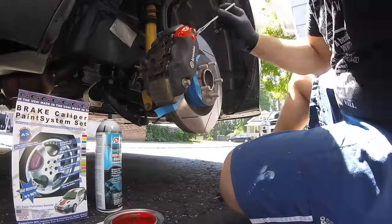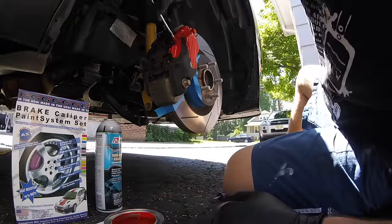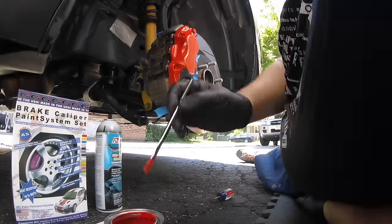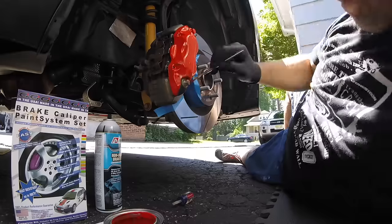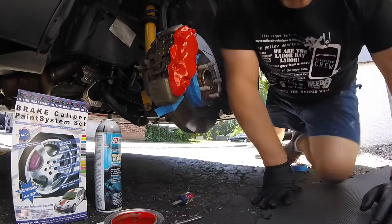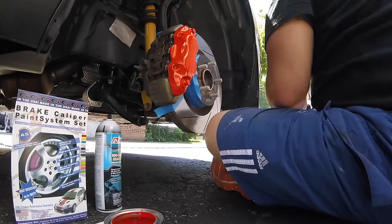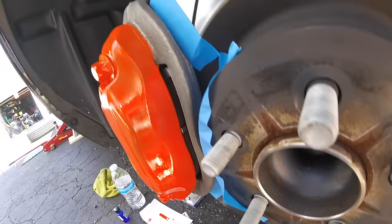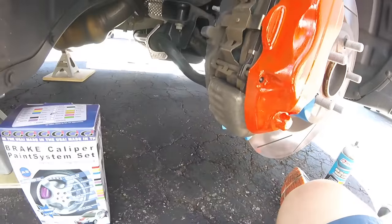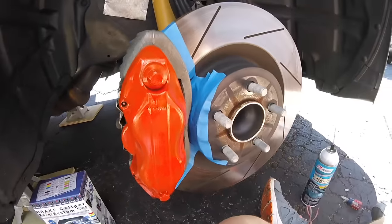Get comfortable — painting takes a while, about 10 minutes per wheel, more if you have a larger area. During the first coat the paint is a bit loose, so apply in light coats and keep an eye out for drips. After a few minutes on the caliper the paint thickens, and if you try to touch up those areas it feels like you're peeling up the paint. Don't be tempted to touch up — this stuff coats really well on the second and third coats, so it'll fill in any brush strokes or flaws.